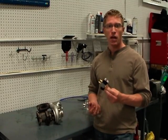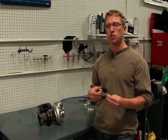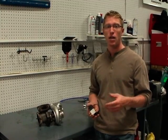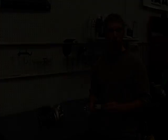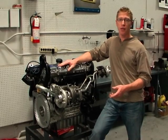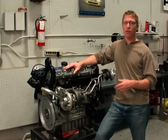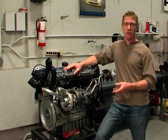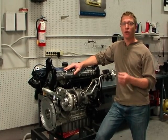The IPD HD-TCV was specifically created to target factory TCVs that get a little lethargic and lazy — they just aren't quite precise enough, especially when you start raising the boost level beyond stock. You need something that's going to be precise and keep you within safe limits for the car and the turbo. So we spent some time talking about turbochargers and related parts today. While this is by no means a comprehensive study, it should give you a basic understanding of what a wastegate does, what the compressor bypass or blow-off valve does, how to adjust them, and what steps you need to take when upgrading your car from stock level to a tuned level.